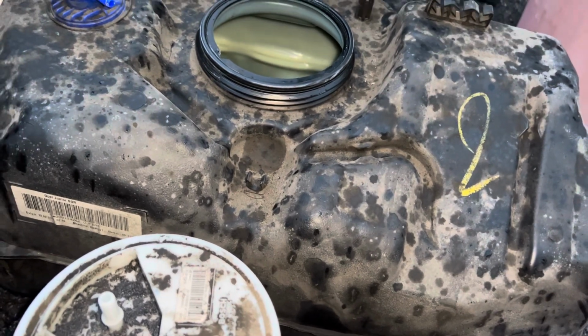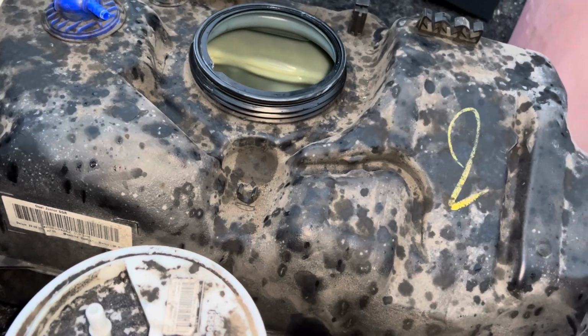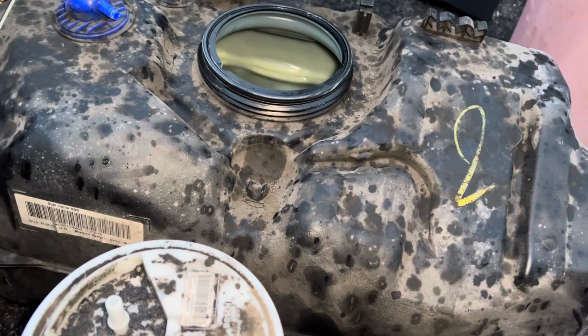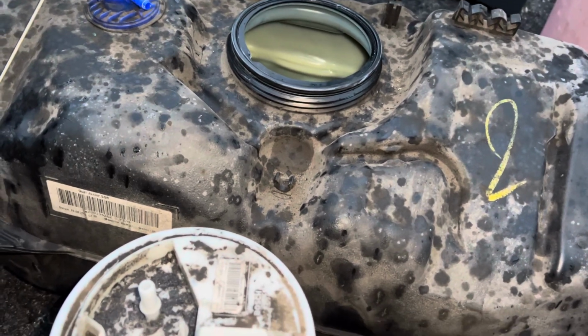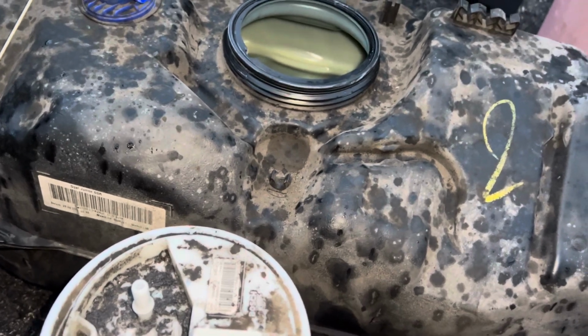So what it is, your speedometer, everything's working perfectly fine. The fuel light's flashing and the fuel gauge doesn't work. So the fuel gauge stays off. Some people call it gauge, but it stays off constantly. Now, there's two faults for that. One can be the ECU needs updating. With the newer cars, that tends to be what happens.